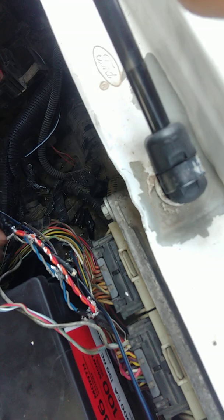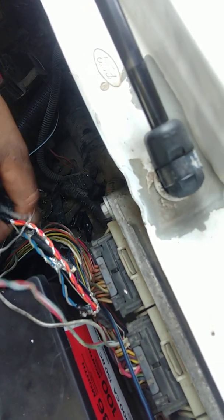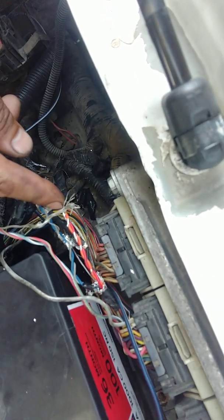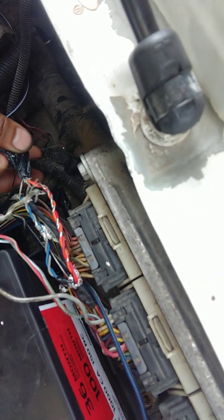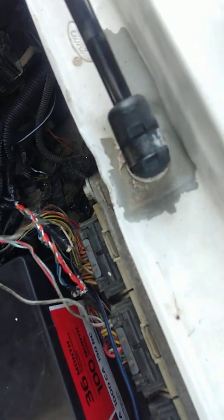There's a ground in here that was wrapped up in a weird way — I have it tied down right now. I went to look at my diagrams; there are grounds that come out of here, but this one was just wrapped around the cable right here. Over time the aluminum foil, which was supposed to be grounding out by touching this foil, was the issue. There are grounds everywhere — you can see them wrapping up the foil right here. I don't know why they did that instead of running a straight wire.